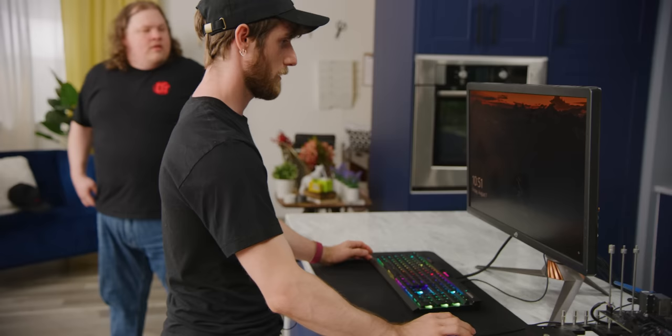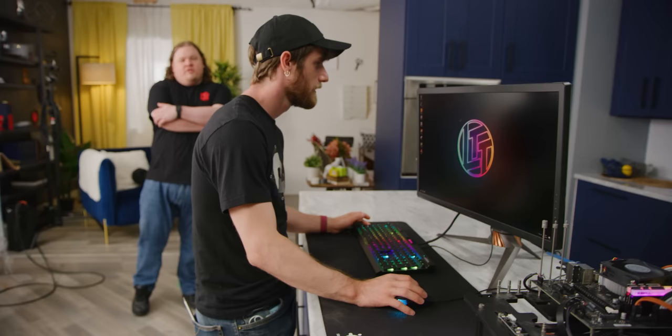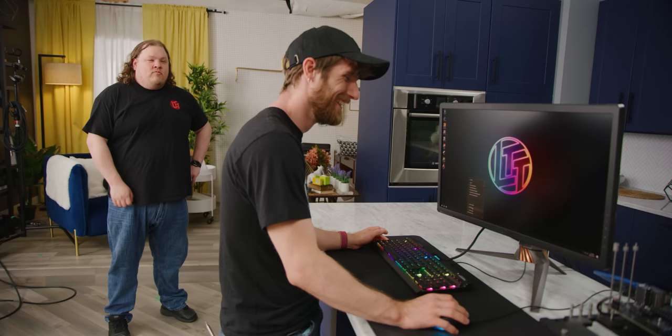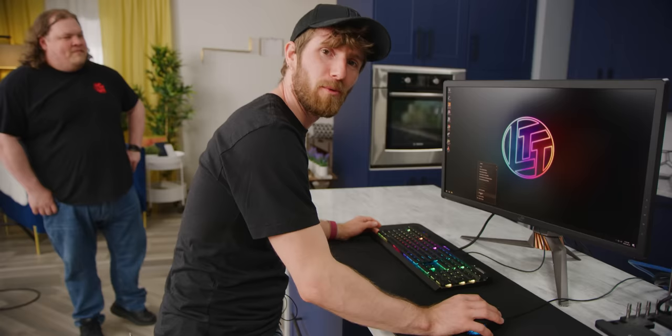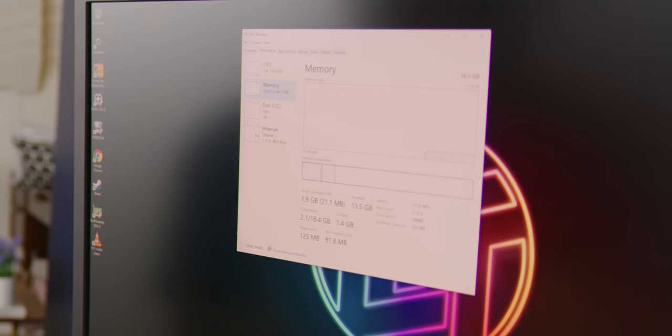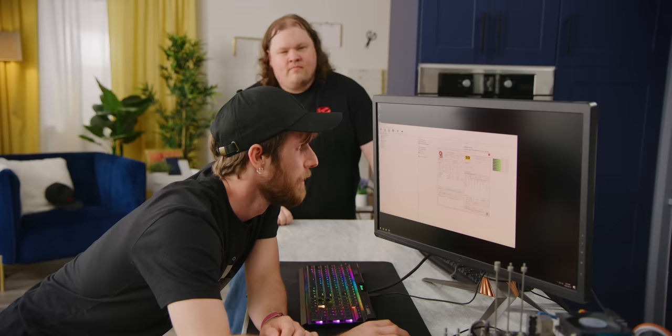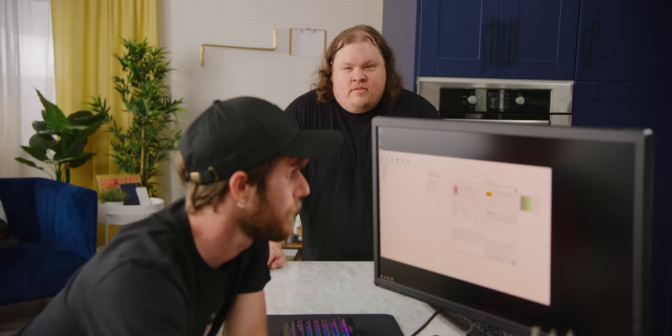We're running Windows right now — 60 Hz 4K with the Zhaoxin C960 series GPU at 400 MHz with a 10-bit DAC. To get the graphics working, I had to dig up a driver from HP's website. HP actually has a micro PC that runs on the Zhaoxin architecture, for sale in China. Task Manager looks completely normal: 8 cores, no SMT, so 8 threads. Memory shows up normal at 2133 MHz. We weren't able to get into the BIOS initially.